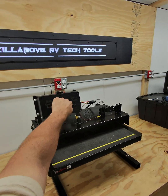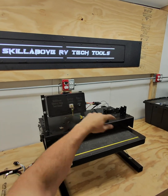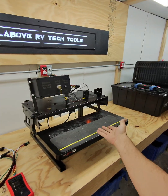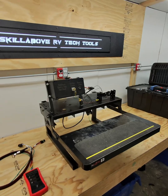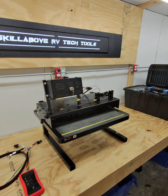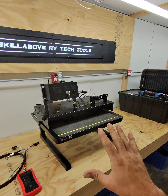Now we turn the ignition back off, we get where we're going, and the step switch is still in the lock position, and we open the door, the steps are going to come out, close the door, the steps stay out. Now if we turn the step lock off, they go in. Okay? That's how they're supposed to work in the normal working condition.